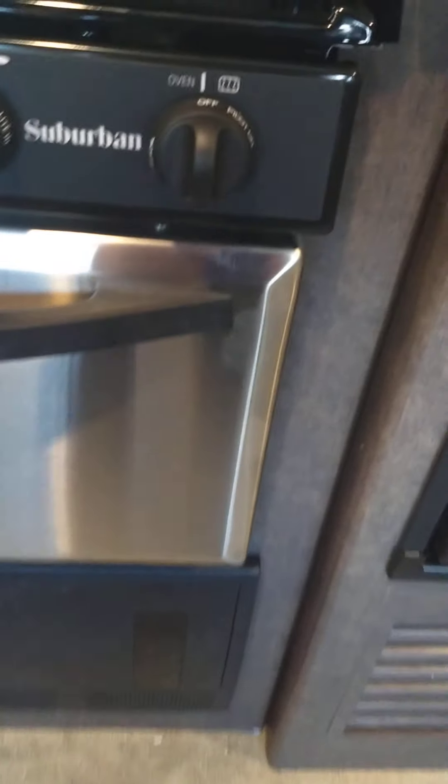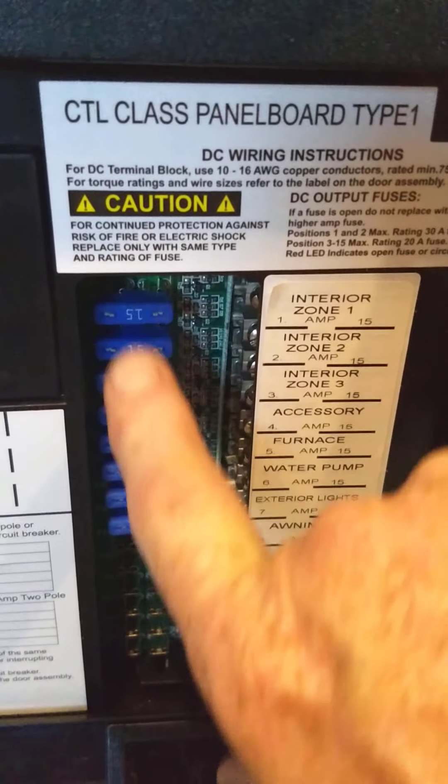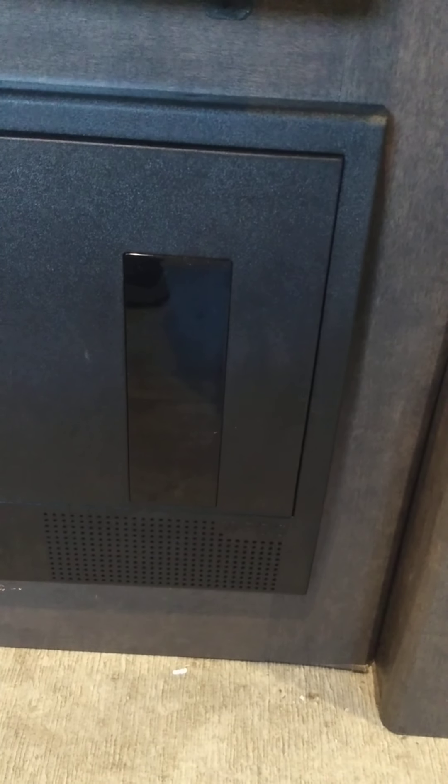This device down here is the power converter. What this does is it converts 110 AC down to 12-volt DC. You open it up like so — this is the 110 AC side with regular household-type circuit breakers, and they're labeled. It converts the rest of the power down to 12-volt DC over on this side, with 12-volt fuses here, also labeled. If any of these fuses were to blow, they'll actually light up and you can see them through this tinted plastic. One other thing this does is act as a battery tender — it'll sense your battery, see how much energy it needs, and always keep it charged as long as you're plugged into shore power.